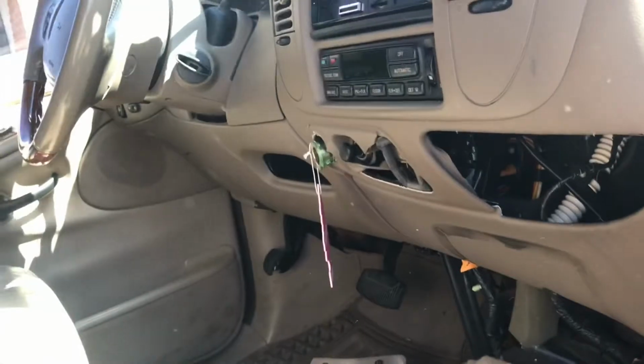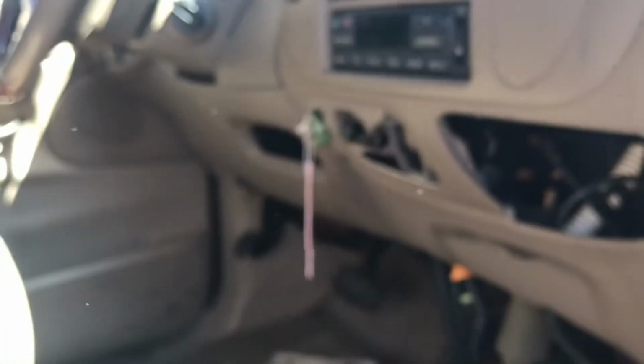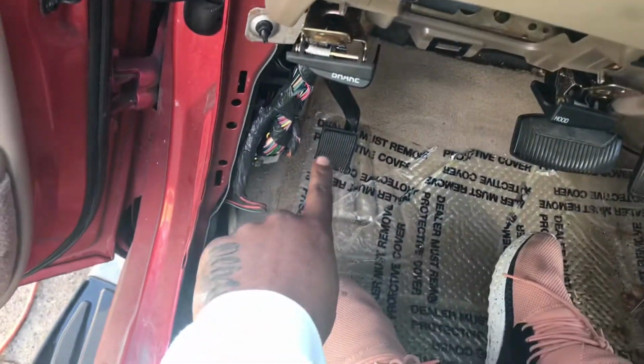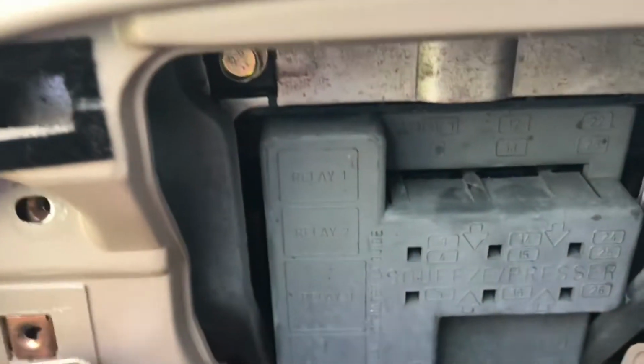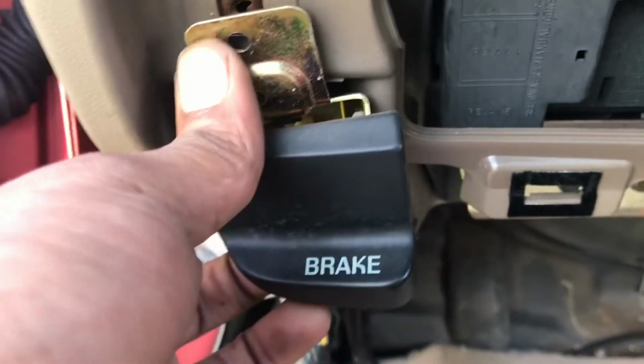I'm gonna move around to the driver's side and get the ratchet. I'm gonna go over here and continue the abyss of freaking nuts and bolts. And on the driver's side, I'll pop off the side panel, then pop off the fuse panel here. And then you're gonna have 2 8mm or 7mm bolts in this, 2 in your hood release latch also. And then there you have another one.